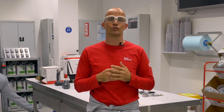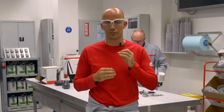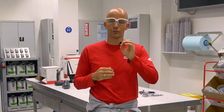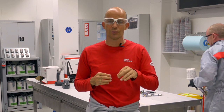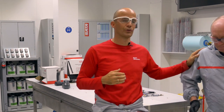He will finalize the job with activated Chromax Pro basecoat and CC6700 ultra performance energy clear, delivering a flawless mirror-like high-gloss finish. The whole paint process is being sprayed and cured without forced drying at 20 degrees C room temperature. Tony, let's get to work.